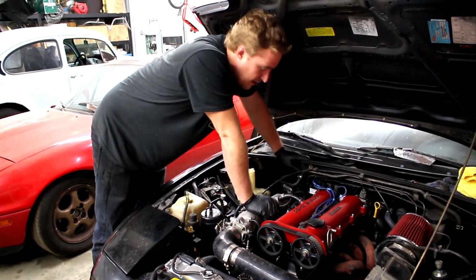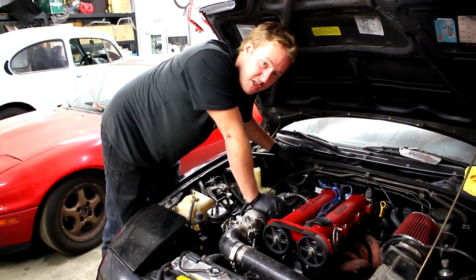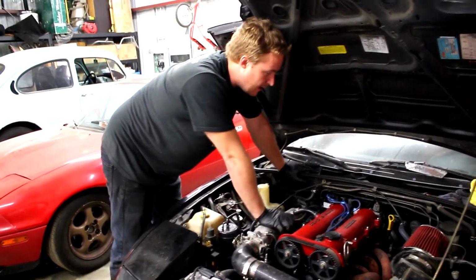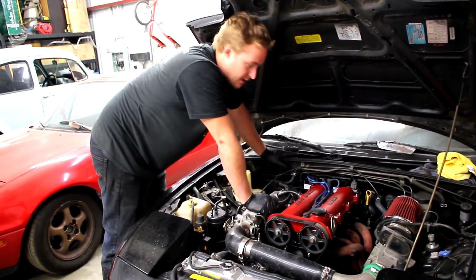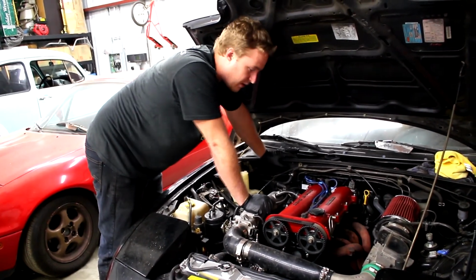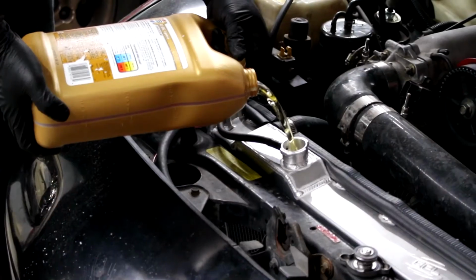And then the fan switch is on there. Now, to test out the fan switch, I know already if I ground out that wire that the fans come on, which is good, but what I'm actually going to have to do now is fill it up with coolant, because I didn't do that yet, and just run the motor until it gets nice and warm. And then as long as that's all working properly, hopefully I don't see any leaks back there from where I installed the fan switch, but if it's all working properly and not leaking, the fan should come on when it hits the right temperature, and I should be pretty good to go here.